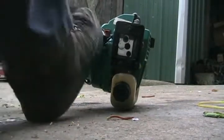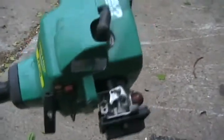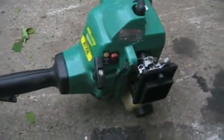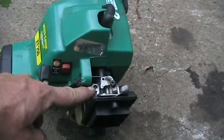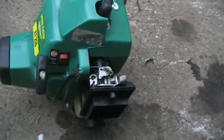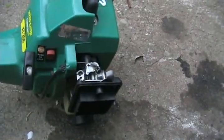So next try I primed it again and see what happens. I messed around with the adjustment screw and got it running right. I hold it full throttle and turn the screw until it starts to run the fastest, then turn it out a little bit more for more fuel until it runs a tiny bit slower — making it slightly rich so it doesn't stall when you start hitting grass. That's how you adjust the high-speed screw. This one doesn't have a low-speed screw; they're usually side by side. I adjusted the idle mixture afterwards and got lucky — a very rare one with a good carb.